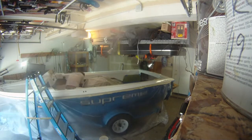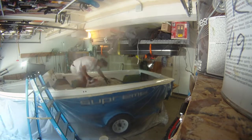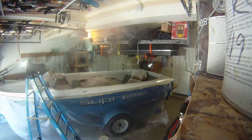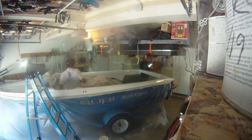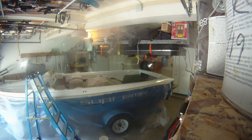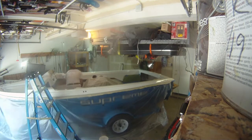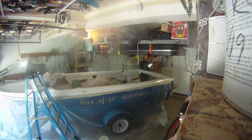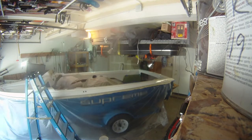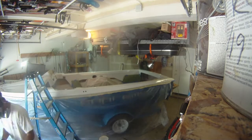Once I had the masking pulled up from painting the deck, I moved on to sanding the floor. I used a hand sander with 150 grit sandpaper. My wife's vacuum makes another appearance. I then finish masking the space and clean the area with the Total Boat de-waxer and surface prep.